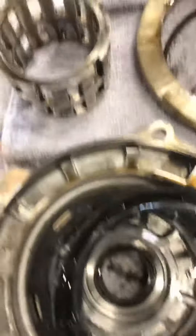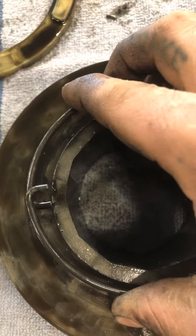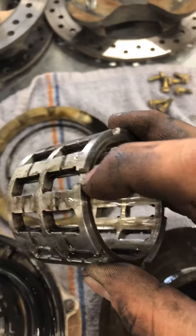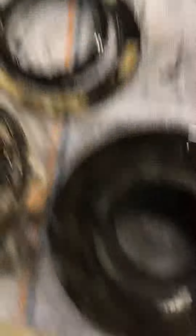It's supposed to be right there, which allows this spring to sit on here just like this, and lock inside that tab, and that engages with the ramp, and everything engages the four-wheel drive. So with that tab broken, you can see all these are around the lips where there's stuff bouncing around. It's all galled up. This is all melted. It's all just dirty and melted, and it just got hot.